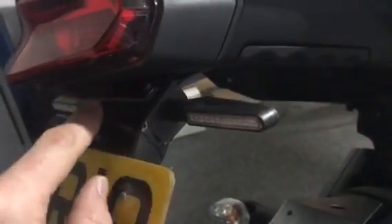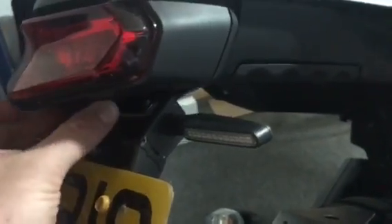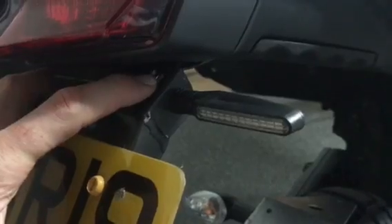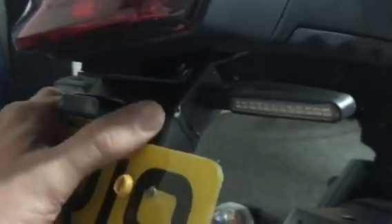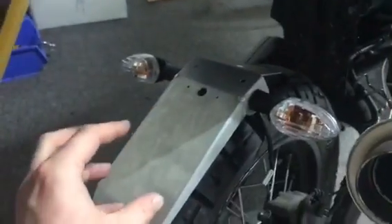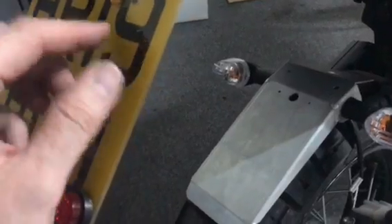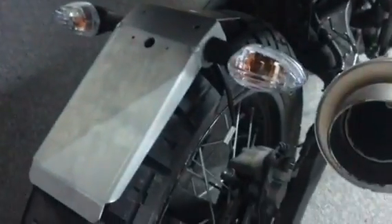This support bit will also be supplied along with the fixings that support the rear light, because it's a bit wobbly otherwise. The OEM rear light from Yamaha — this bit that you cut off actually supports the bottom of the light. This piece replicates that and helps bolt the section through into it to hold it into the steelwork, adding a lot of strength. I wanted an actual little mudguard rather than just a thin, spindly tail tidy that relied on the number plate as your fender.